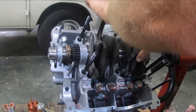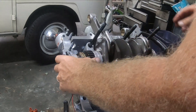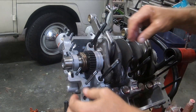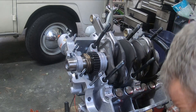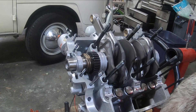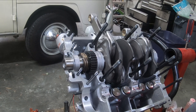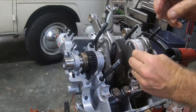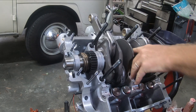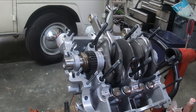It's turning nicely and the distributor is turning. Let me take a look and make sure it is seated properly with my dowel pins — this all appears okay. The way to check it is with the other bearing: I'll pop it out of my case half. If I put this on here and it doesn't rock at all — which it doesn't — that means it's perfectly seated. Put this back in the case, I'm ready to pop that together.